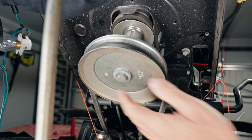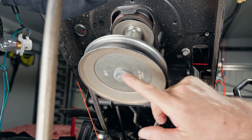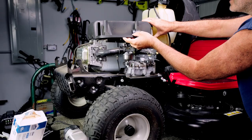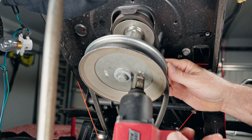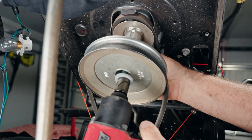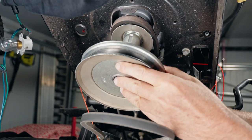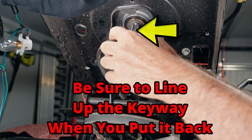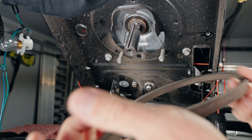Now we need to get our pulley loose. This bolt is a 5/8 head right here and it does have some Loctite on it, so it's pretty tough. If you don't have an impact, you'll probably have to take the top of the engine off and find a way to lock the flywheel up without breaking any of the cooling fins. But I do have an impact, so we're going to go the easy route. Now let's get our deck pulley out of the way — very easy with the guard gone — and drop it down right like so. There's no fancy routing; this belt goes straight from here to the pulley on the back, so it comes straight out just like that.